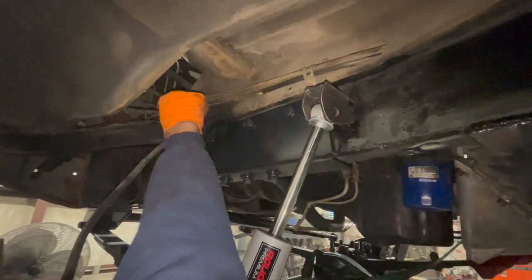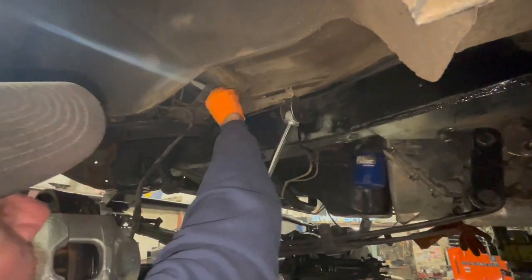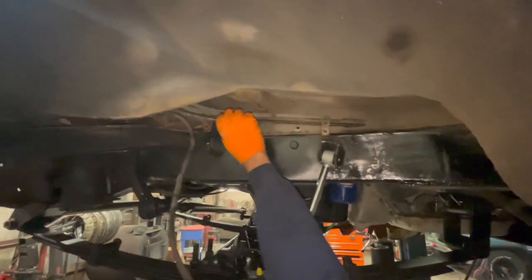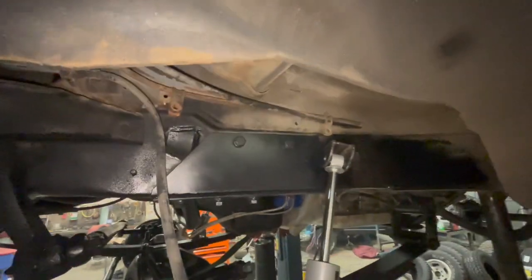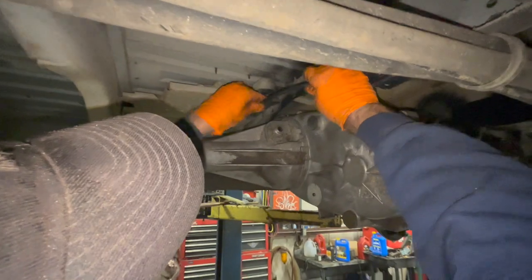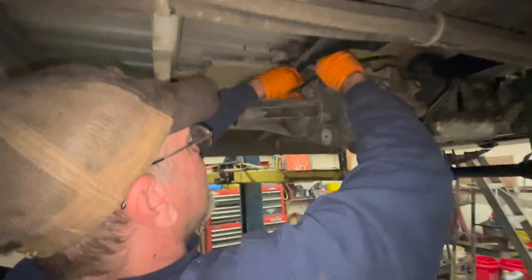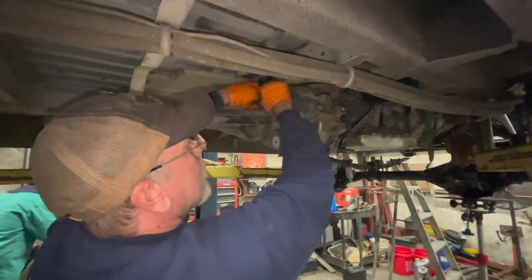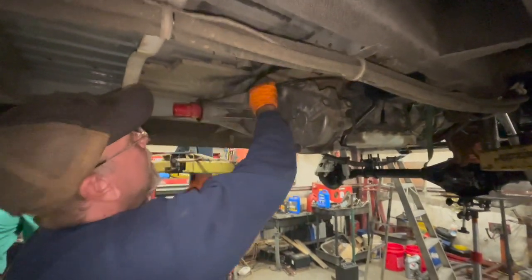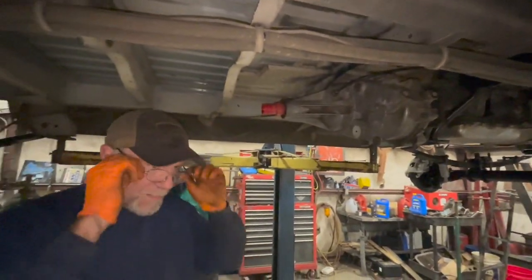Okay, I got up there and I did pull the relief out that you can get up there at the battery cables. So now that I pull that through, that should give us enough to where we can get it pulled around here into the speedometer housing. So there you go. Now that's a way you can use the factory speedometer cable when you convert your van to four wheel drive without having to buy a new speedometer cable. It's that easy.